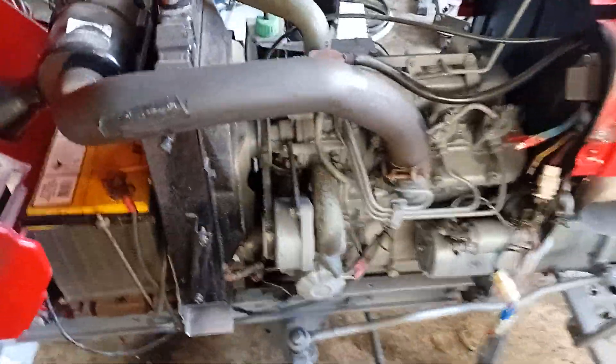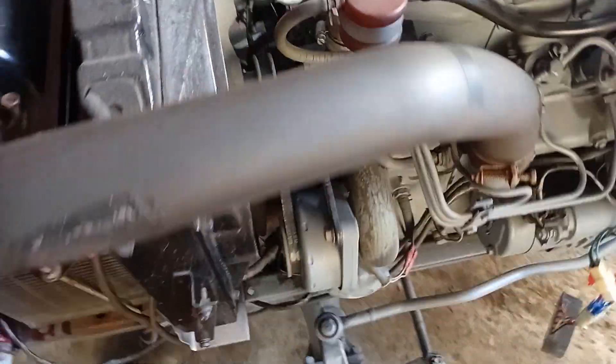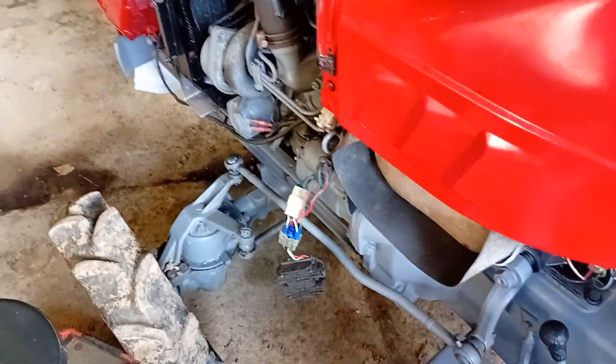One more thing: if you're going along and the light comes on, stop pretty quickly, because the fan belt right here may have broken — and that belt is oftentimes also running your water pump, so the engine is in imminent danger of overheating. That's another reason your light might come on. That's it, hope it helps somebody.